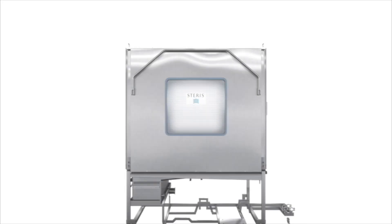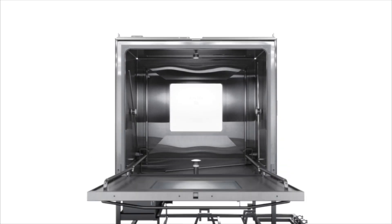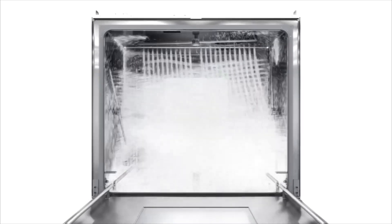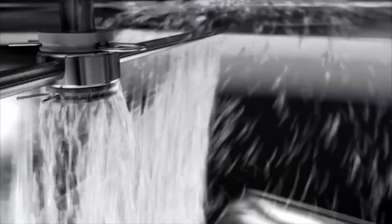The pre-rinse is the first burst of warm water via the spray arm, which gets all the dirty dishes wet but doesn't really do much cleaning. Step two: the main wash. This is the main part of the wash cycle that uses recycled water. The water is heated, sprayed, collected, filtered, reheated, and resprayed. At the end of the main wash, all of the water is drained.